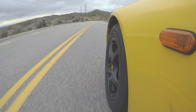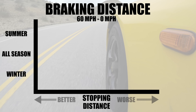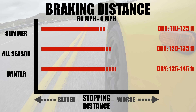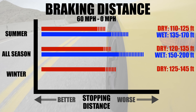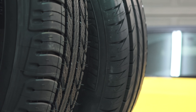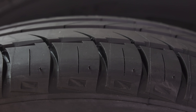Now that we understand the physical differences, let's talk about what this actually means for the driver — what sort of braking and cornering should you expect depending on the tire and conditions? In dry braking at relatively warm temperatures, summer tires perform the best, stopping from 60 miles per hour to zero in about 110 to 125 feet, versus the longer distances with all season or winter tires. What may come as a surprise is that in rain and wet conditions, summer tires still perform best, stopping from 60 miles per hour in about 135 to 170 feet. This really shows the importance of compounds, which play the largest role in grip overall. Since summer tires tend to have the stickiest compounds, they perform best whether it's dry or dumping rain, assuming the tires haven't worn down too much and can still evacuate water.